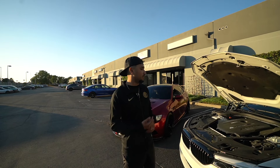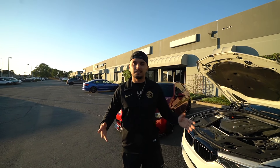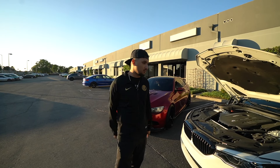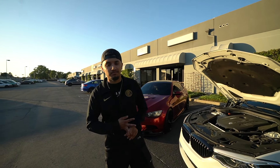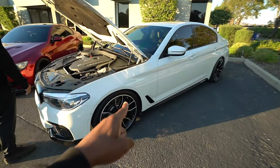The plan was to just go big turbo and upgrade the fuel pump — that's all you need to do, and you're already pushing like 650 horsepower. You could go higher or lower; I'll probably stay in the low 600s just to be safe. I don't want to have to build the motor — it's not really the motor that can't handle it, it's the transmission. Everybody with a B58 knows that around 700 horsepower, the transmission is a ticking time bomb.